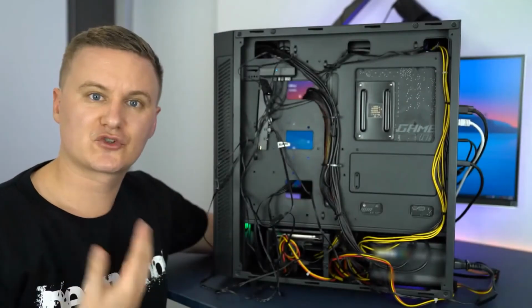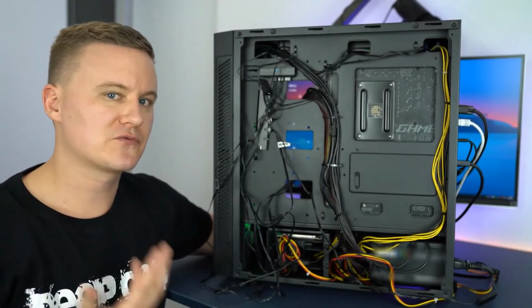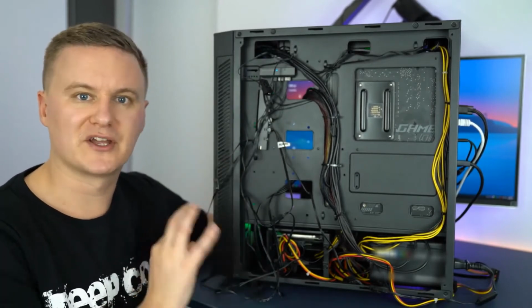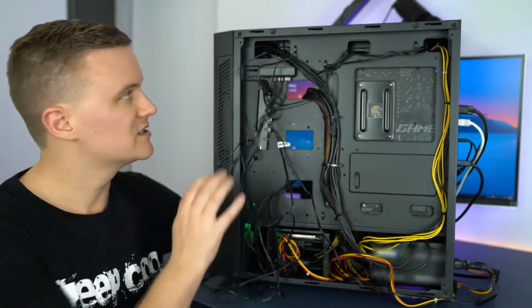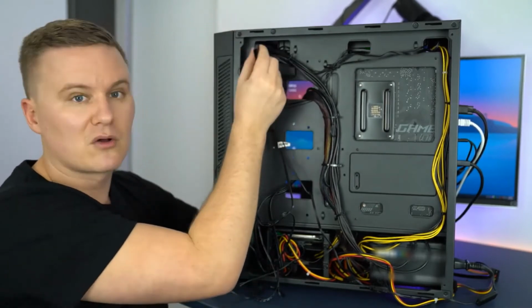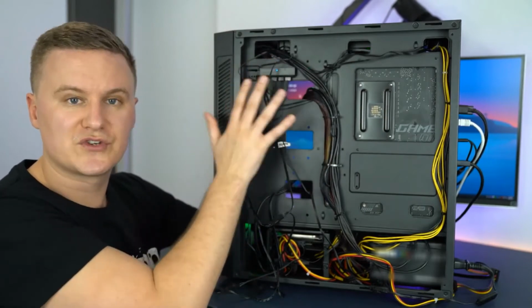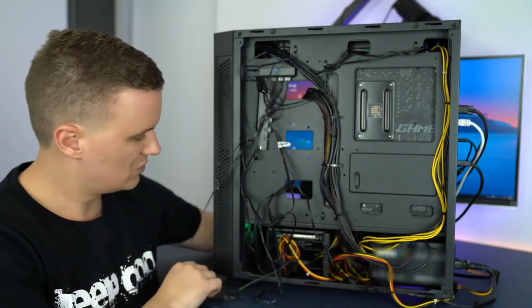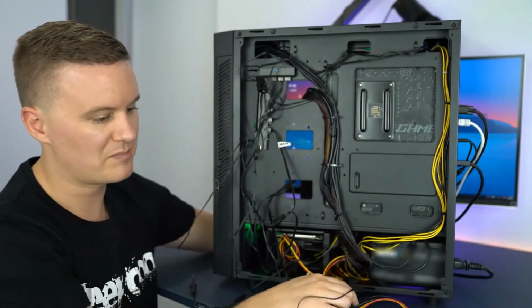So lastly, with the troubleshooting element of this, there's really one rule, and that is that you don't run both in combination with each other. What I mean by that is if you're going to choose to control the RGB lighting with the button on the top using the Molex connector, then you stick with just the Molex connector and you do not connect the SATA power as well.